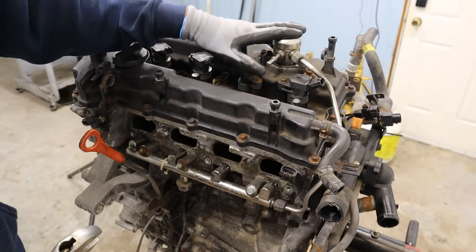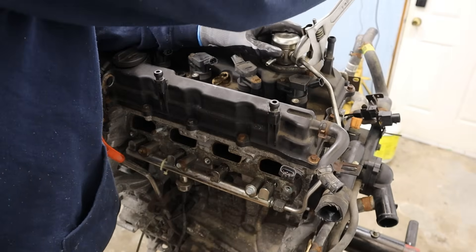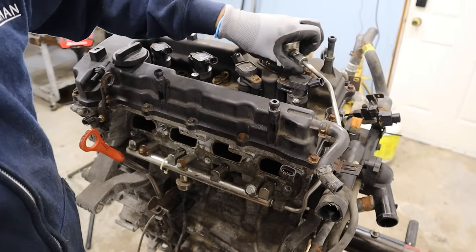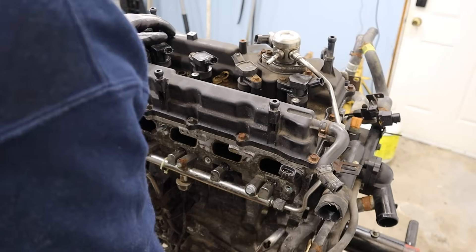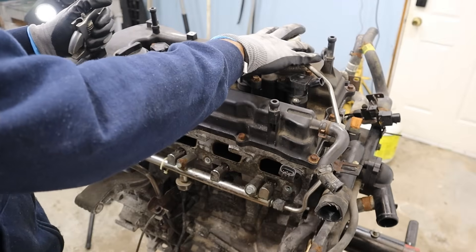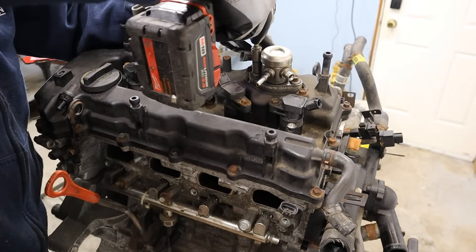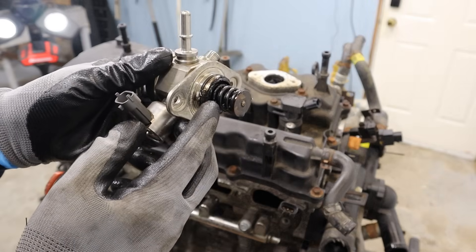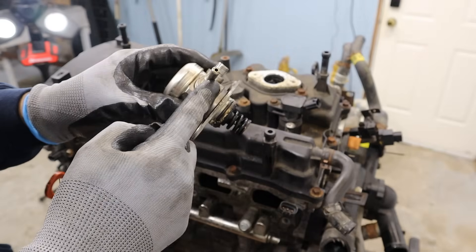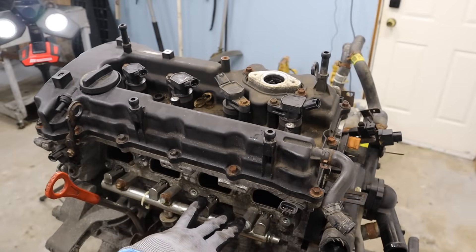Next I'm going to turn my attention to the top of the engine where we have the direct injection pump. I have to first remove this fuel line here — this is the subject of a recall where it could leak and cause a fire, so make sure you get that done. You'd rather have your engine replaced under warranty than by insurance. You also have to remove this line in order to do a valve cover gasket job, because the gasoline direct injection pump sits on top of the valve cover. The pump itself is held on by two 10mm bolts. Essentially you've got a giant spring with a lobe that pushes up and down, bringing low-pressure fuel from the tank, pressurizing it to many thousands of PSI, and pushing it directly into the cylinders.